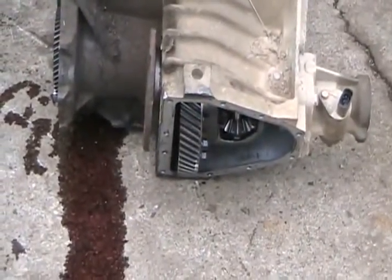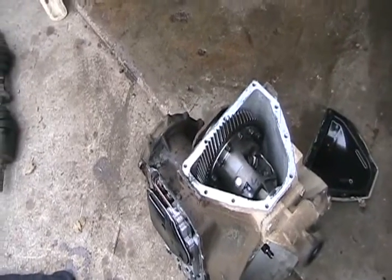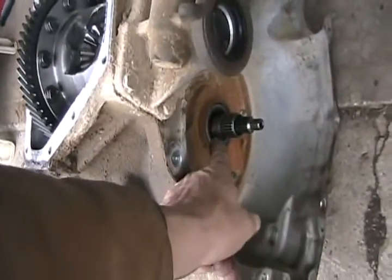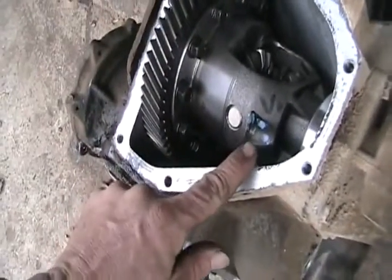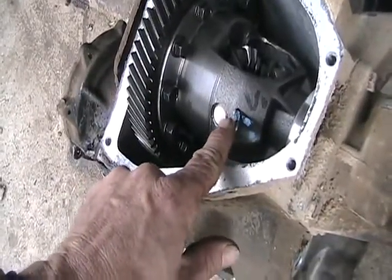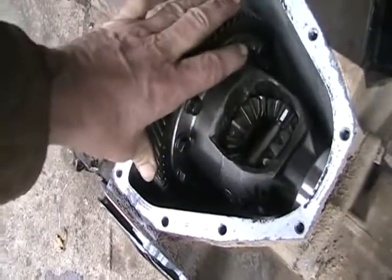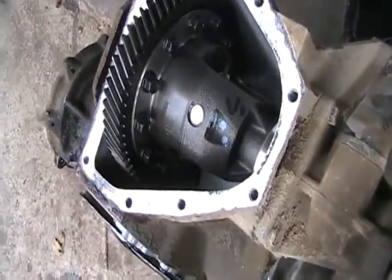There you can see the differential part and even one of the spider gears. All I've done is remove that service access cover. One thing to note about these Chrysler units: if you have one leaking out the bottom of the bell housing, everybody would assume it's the seal that goes on the torque converter — but that seal probably never will leak on a Chrysler. What happens on these three- and four-speed automatics is that there's a little tiny one-eighth inch roll pin pressed through a hole in the pin that supports the spider gears. On higher-mileage vehicles, that roll pin just breaks for no reason at all, and you have no idea it happened.